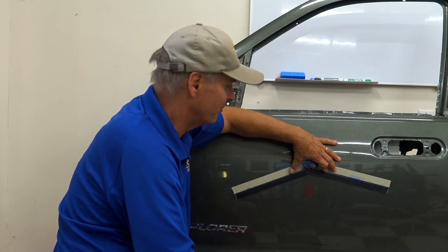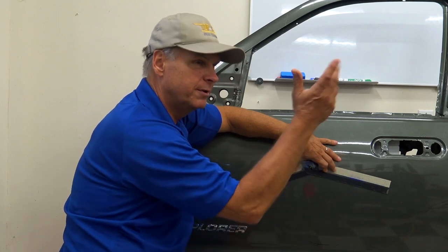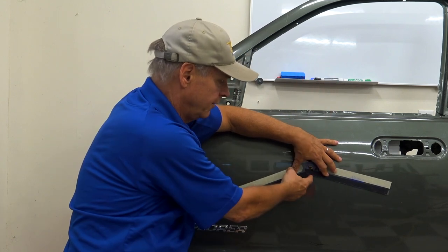And I'm sure you both heard the term popper dent, right? You both heard the term popper dent? Oh, yeah, popper dent. Sure. You get in back of it and push a little bit, the dent pops out. Well, that's a dent that the crown barely got past the breakover point. Just barely. And so if you just pop it out, you're still going to have a little bit of crown there, though, right?